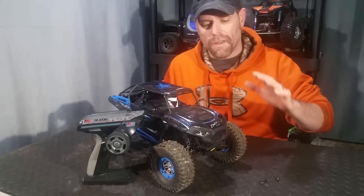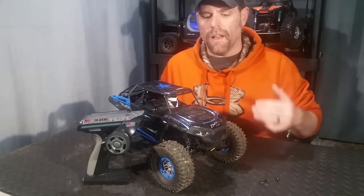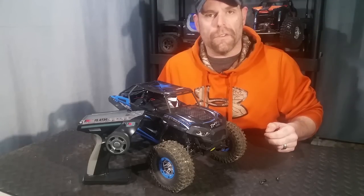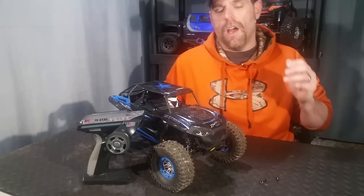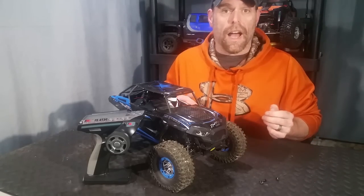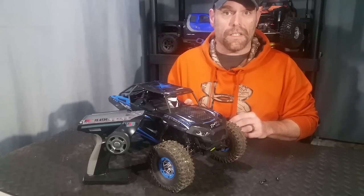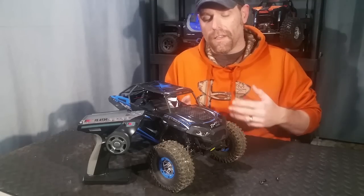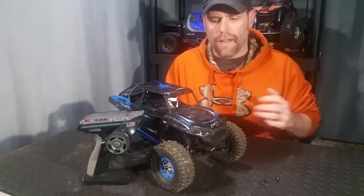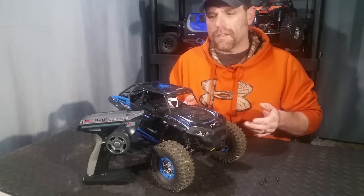So like I said in the intro, this is going to be the last upgrade video in this series. I will have an additional follow-up video where I summarize all of the upgrades we've done, give you a little bit of background as well as my thoughts and feelings about the vehicle and how it turned out, and we'll do some running footage so you can see how it performs with the new setup. But first we need to get finished. The one thing we've avoided so far in this entire upgrade has been the electronics. We've been running with the stock electronics and so far they've been pretty good. The servo was really weak and that was really the biggest problem with the stock electronics. But because it's a five-wire servo, you need to either invest time into modifying a three-wire servo to work, or just upgrade the electronics — and that's where I decided to take this. Today I'll go through all of the new electronics I've chosen and give you some background as to why I chose what I did.